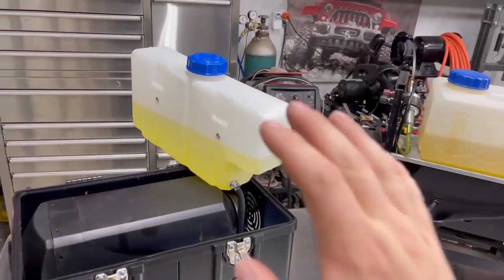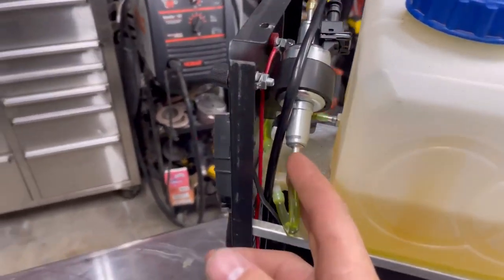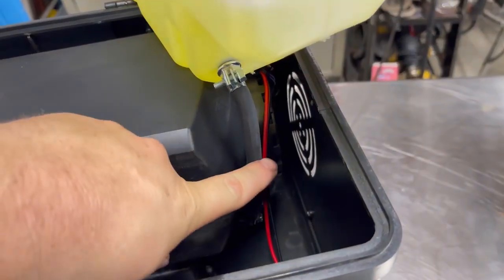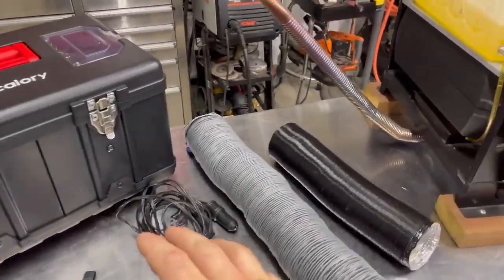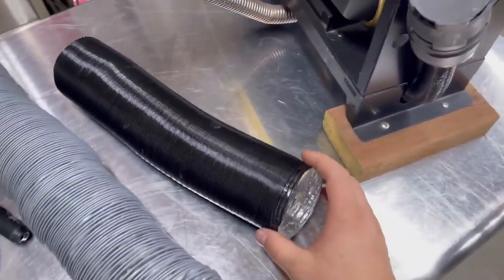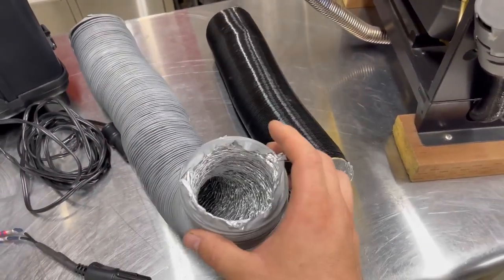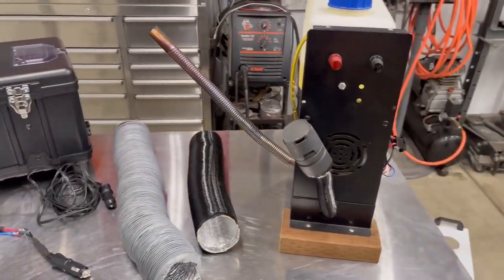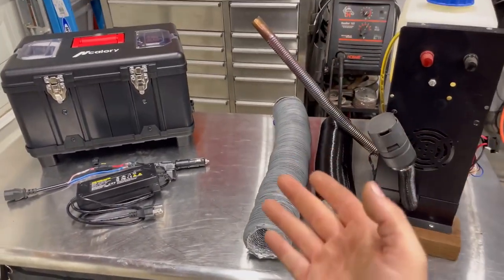A couple other things to note: this is a 6-liter fuel cell, whereas the older one is only 5.5 liters, and the fuel pumps look very similar. This new one came with a fuel filter, whereas the older one did not. I'll definitely be cutting the tube here and adding my own filter between the tank and the pump. Lastly, the new heater did not come with ducting, whereas the older heater did come with some 3-inch ducting — though I ended up upgrading to a much longer, better quality duct that reaches from the floor up to the tent on my Jeep. I'll leave a list in the description of all the items I think you should buy as a first-time diesel heater owner.